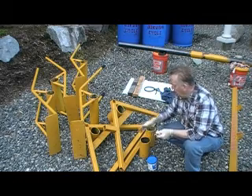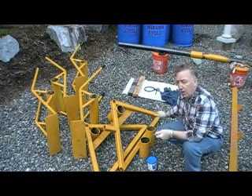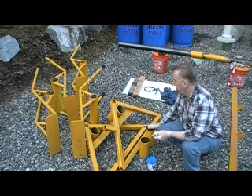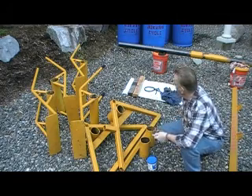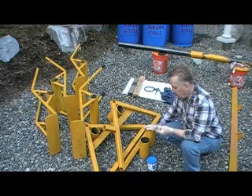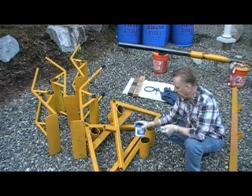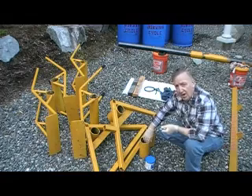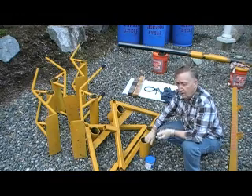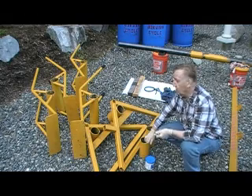In addition to the components, you'll want to have a rag handy because you're going to need to wipe any material that needs to be taken care of and removed. We need a couple of two-by-fours and a couple of five-gallon buckets, which can be used to support the axle during the assembly process. You also want to have some heavy-duty wheel bearing grease or something equivalent to put on the spindles that will be sliding over the axle — a good idea to replace periodically every six months to a year to keep things working smoothly and to protect the axle from corrosion.